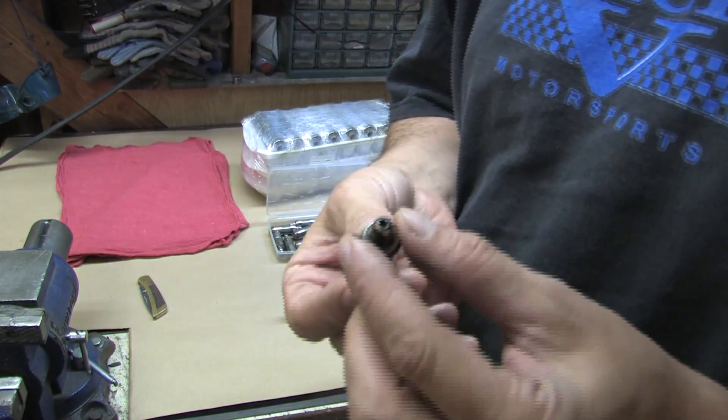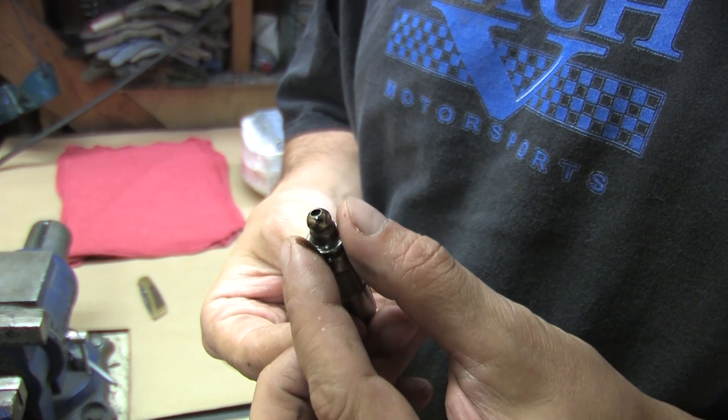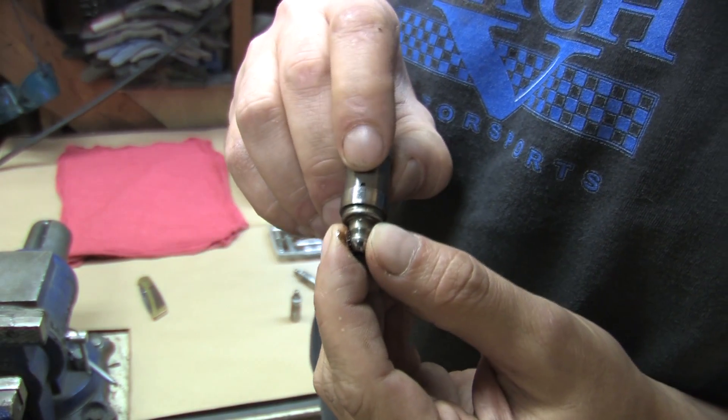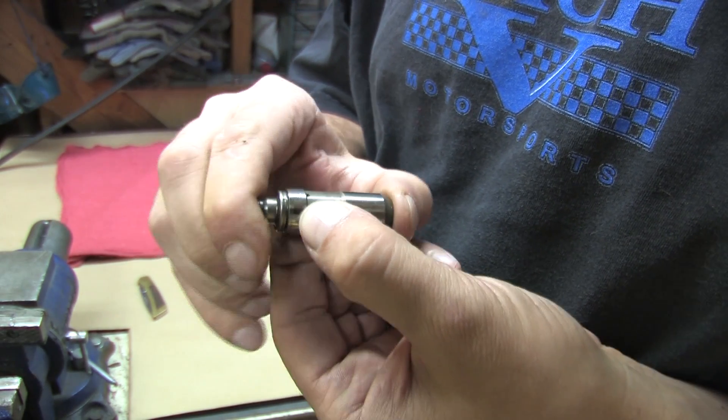Second generation lifters stormed onto the scene with a bigger oil hole on top. You'll notice the cap holding it on was pressed on with precision, unlike the bottle cap style caps. The oil supply P-hole is also half the size of the previous, oriented in a deeper oil groove and drilled higher into the outer sleeve.